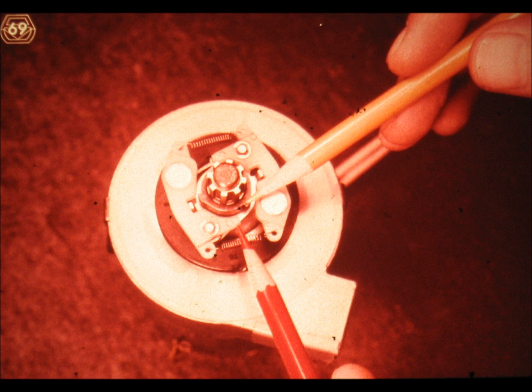Notice that only one pawl can engage with the motor pulley at one time. The other pawl just rides along. It is most important that the pawl heels be in good shape, showing no signs of wear. Occasional slippage or jumping from one tooth to the next will primarily cause impression problems.